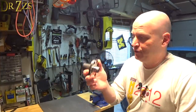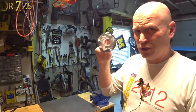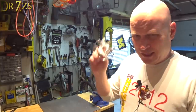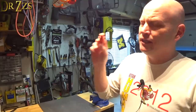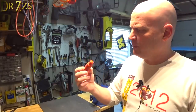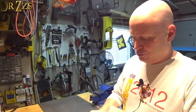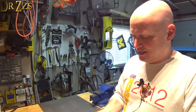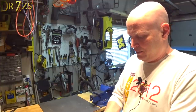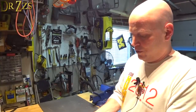So today's the day that I'm going to weld together the adapter. This is the piece that goes on the forklift motor. This is the piece that came from the Volkswagen clutch. This is a 3D printed guide that I made so that I could line up the centers of these two pieces exactly, because I want to make sure that they totally line up. They have the exact same center point when I weld them together.